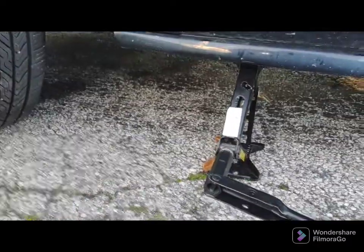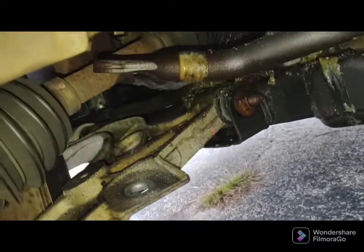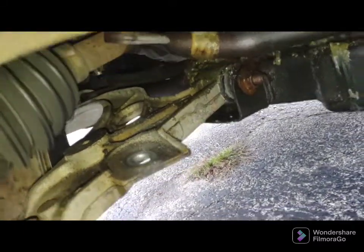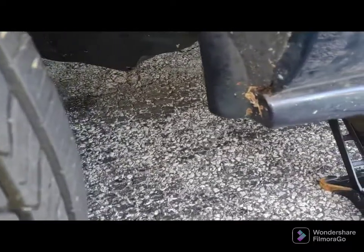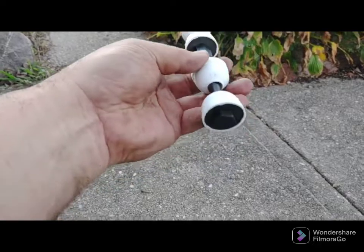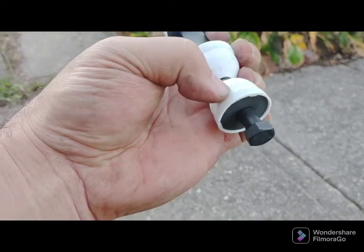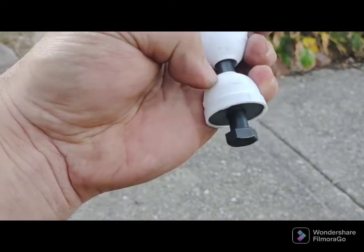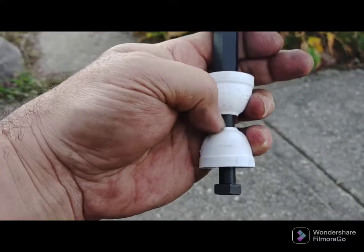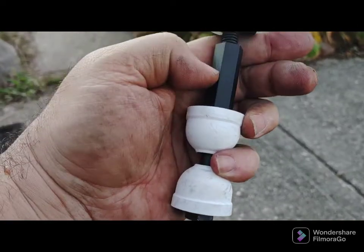With the light on — all jacking up does is increase the gap between the control arm and the stabilizer bar so you can put your parts in. Make sure you put the washers in — there are three washers and the shoulder washer that's part of the nut on top. The bolt head is on the bottom; there's a washer inside the bottom polyurethane bushing, and the tapered part goes into the control arm at the bottom. Then another washer, and then the aluminum hex spacer.